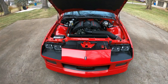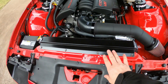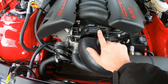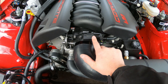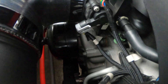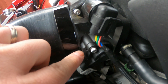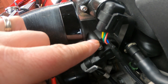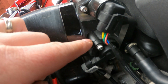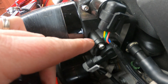This next step is pretty simple — you only need a Phillips screwdriver and a set of Allen wrenches. This applies only if you're running the factory Fitech throttle body and having issues where you cannot get your IAC steps set below 30 or 40 and your TPS is not reading zero. On the TPS sensor you'll see two sets of screw holes. On my Fitech throttle body it was in the wrong screw hole — I could not get my IAC steps below 40 and my TPS was reading around three. You cannot set your IAC steps until your TPS is reading zero. You have to unbolt those two screws and rotate the TPS sensor to the other set of holes.